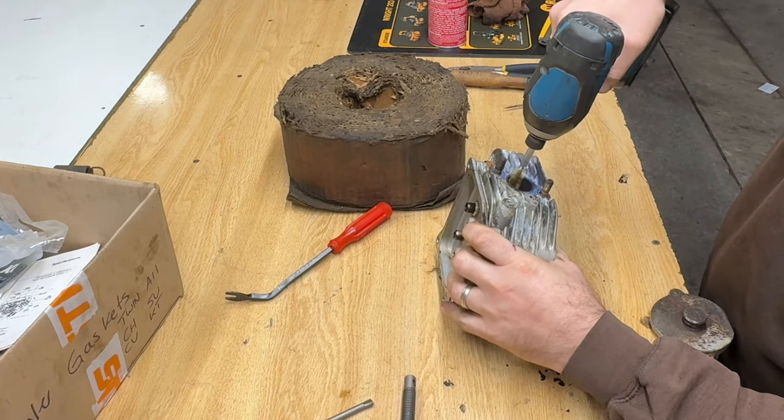I'm going to service that transmission also. I've got the filter in stock, I've got the oil, so I'll be peeling that fender off and cleaning it up really good. It's filthy, dead grass all over it. I'm ordering the drive idlers for this, the new drive belt, full deck rebuild. The deck's getting completely stripped down, all new moving parts. There won't be much left to do on this.